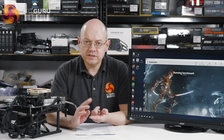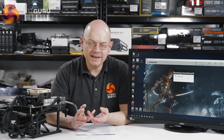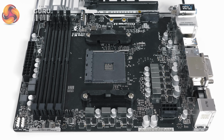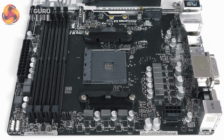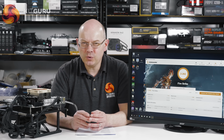The Ryzen 7 1700X overclocked reasonably well, but it wasn't great. But then, are you really that stressed about the difference between 3.8 GHz, 3.9 GHz and 4.0 GHz? Probably not at the end of the day, but it is an absolute fact the VRMs on this board are not the finest quality. They support the processor reasonably well, certainly at stock clocks. Once you get to 8 cores and you start overclocking, you're into questionable territory, which is why, in my opinion, the BIOS is so basic.